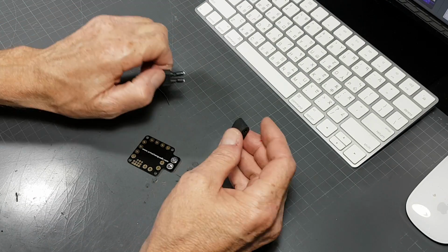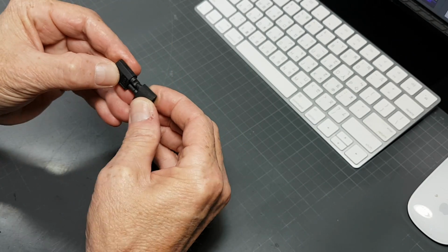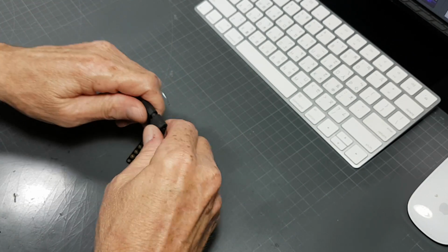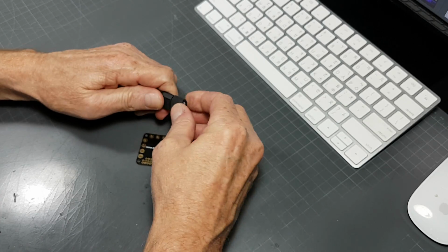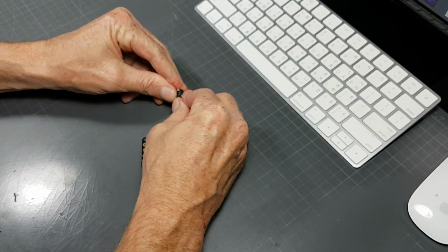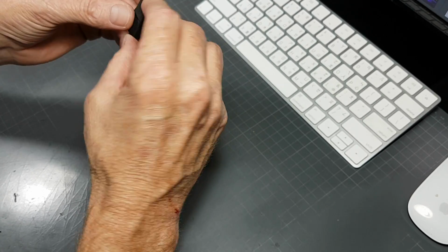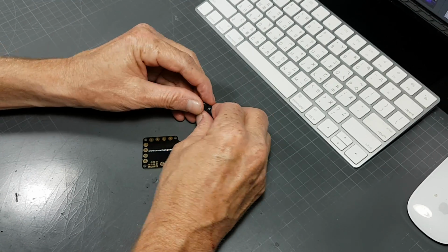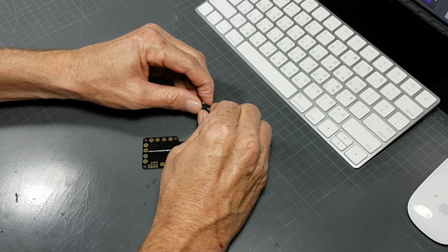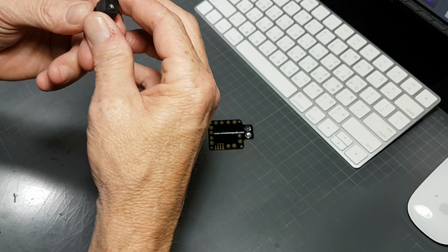I'm going to go ahead and put the connector saver onto my pigtail. All the way in really nice and tightly. Now, I've had that on already because I put it on to measure my wires, and then I cut the wires, then I remove the connector, and then I tin the wires.